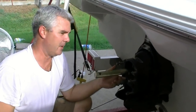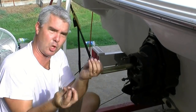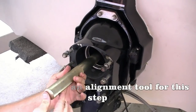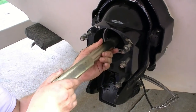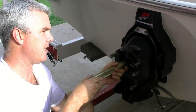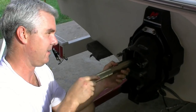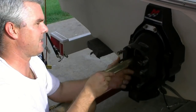I know I've gone over and made a video of this before, but I figured I'd show it to you again. It is all done with the front engine mounts — not the back engine mounts — and you use the bottom bolt to lift or lower each side. What you want to do is look at how your splines make marks on here. You want it equal all the way around. You want it this easy — I'm barely pulling it in and out. It's that simple, it's that smooth. You don't want any binding whatsoever. Sometimes you have to take this and kind of bump it up and down or in either direction to adjust your gimbal bearing just a little bit so that it's in perfect alignment. This is absolutely smooth as silk. I'm very, very happy with that. Now we'll go re-tighten everything, make sure it's 100%, and then check it again. This is a very time-consuming and patience-testing project, but that's how you want it — it's that simple. Once you're in the bearing, it just pops right in.